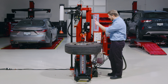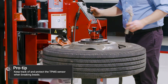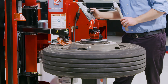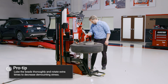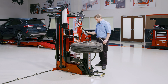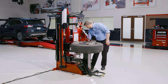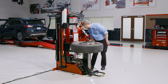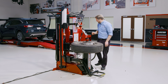Now go ahead and start breaking the beads. I've got the thick bead hook on my Maverick — you're going to definitely need that thick bead hook doing any of these type of assemblies. This is a load range H tire, actually a 16-ply tire. Another essential part of doing these assemblies is bead lube. You're going to want to definitely make sure you lube these upper and bottom beads as you're breaking them. Don't be shy with bead lubrication on these — these are tough, tough tires at 16-ply.